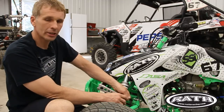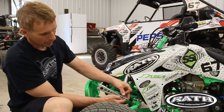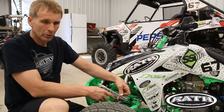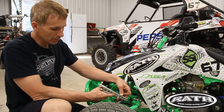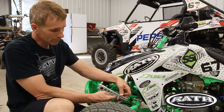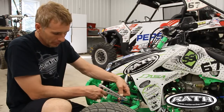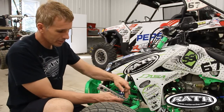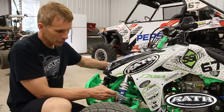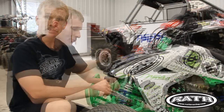What I would do if I was at the track with that problem: take your sway bar — if you're in the second position or wherever you're running — and just move it forward toward the pivot point. Shortening the leverage increases the rate of the sway bar, making it stiffer. Move it forward on the vehicle. You always do both sides together — whatever hole you use, you always use the same hole from side to side.